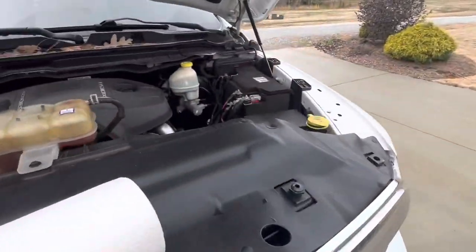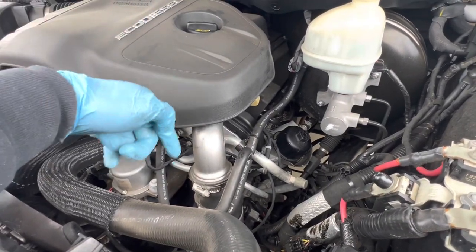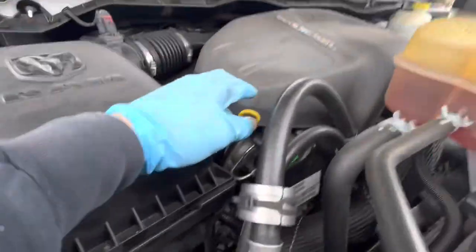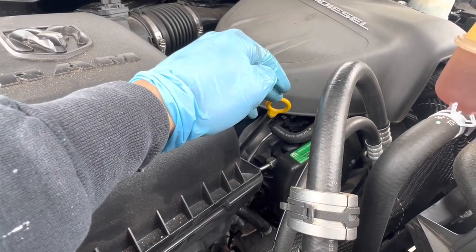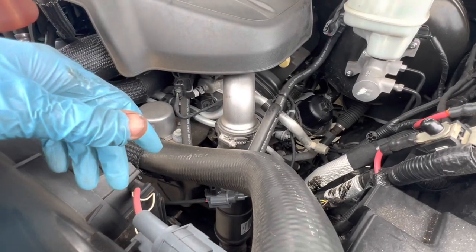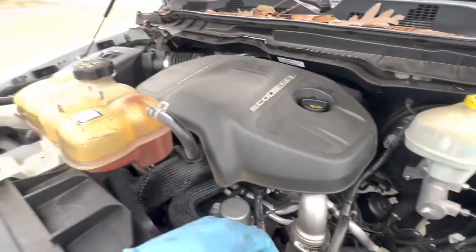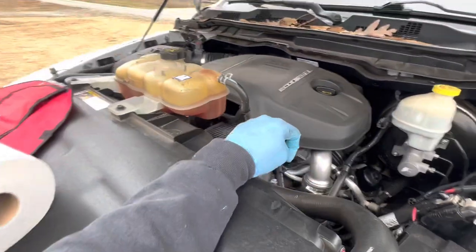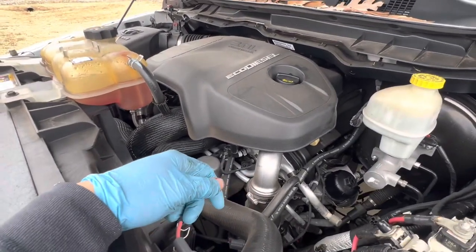One more thing — you see how this filter is on top? When you put oil in, it's going to go all the way to the bottom of the block. So when you check your oil before you start, make sure it's at least to the middle or to the max. What I'd recommend is starting it up, letting it run for a minute or two, let that oil circulate throughout, and it'll go to where it needs to be. Usually you'll check it again and it'll seem to drop a lot — then fill it back up and you'll be good. That's a little tip. I appreciate you guys watching, hit the subscribe button, and we'll see you on the next one.